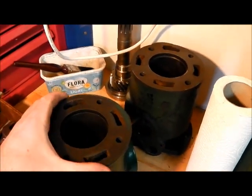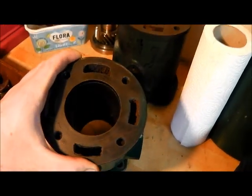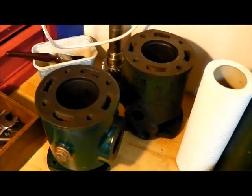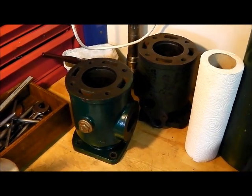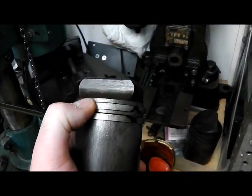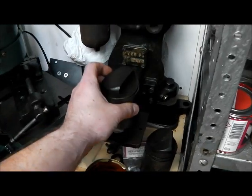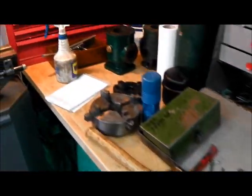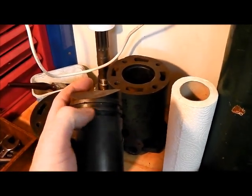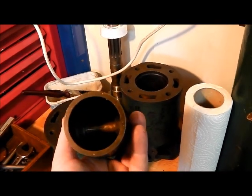The cylinder is the main sticking point. I've mentioned before how worn it is — if you look down there you can see the wear marks. You can get a 20 thousandths feeler gauge past the piston; it's really badly worn. The ring lands are badly worn too. Look at that — that's a seriously hard-worked engine.